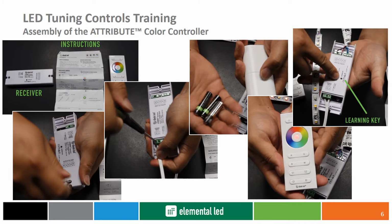Step 4. Quickly locate the learning key found on the face of the receiver. Press and release the button and immediately swipe your finger on the color wheel of the remote control. The LED lights on the receiver will flash.